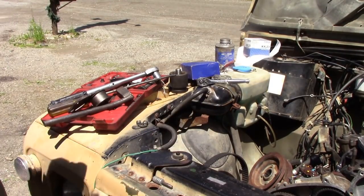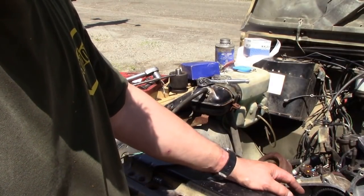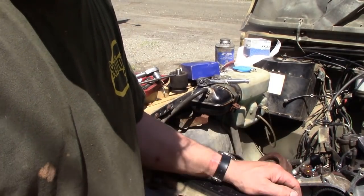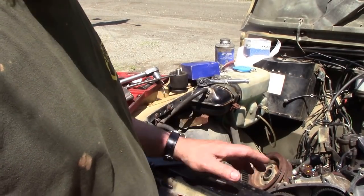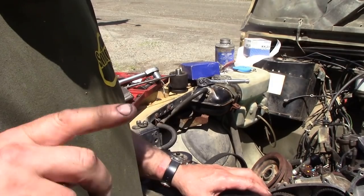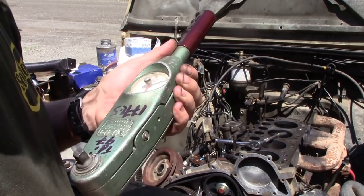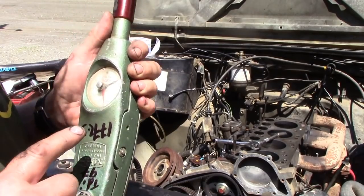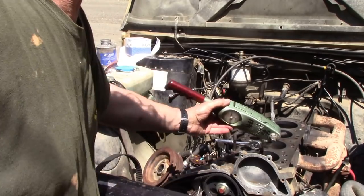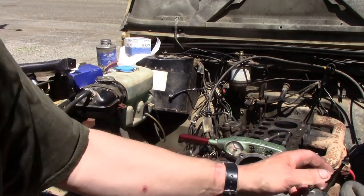It's been an hour or so since I last looked at this. To recap: the keyway in the crank has a habit of chattering on the 2.5 diesels, but it's really tight on the crank and really tight on the pulley, which means we won't have issues with timing fluctuating. I've got my dial gauge here — I've worked out the belt tension has to be about 20 to 23 Newton meters, and 20 Newton meters is 177 inch pounds. I've initially set it up but I've noticed something quite interesting you should be aware of.